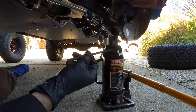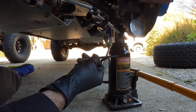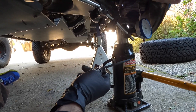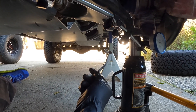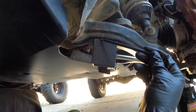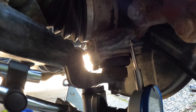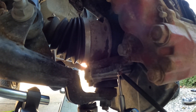So here's the setup. We're first checking out the play on the driver's side front. I have a bottle jack supporting the weight of the vehicle completely. I have a six-ton jack stand as a backup in case anything happens to this bottle jack — that six-ton jack stand will catch the weight of the vehicle and I won't get crushed. I have my magnetic base attached right here to the edge of the front part of the arm, extended out, and the needle of the gauge is right underneath this little appendage which is right underneath the brake caliper.